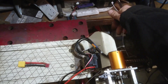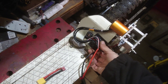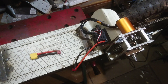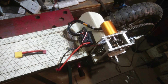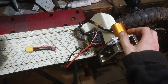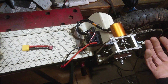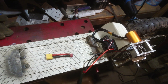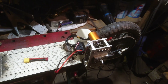I don't know whether to test it or not. I'm going to use a bit of super glue instead of sticky pads to hold this down - if not I'll build a bracket. Until the new motor turns up we are stuck with this one. I'll be keeping the speed control unit for as long as I can until that probably burns out. The new motor is wider, longer, bigger, better - it's 2500 KV so I went with a lower one for a bit more torque. Until next time guys - the next time will be a full test. Have fun, like, subscribe, and please share.